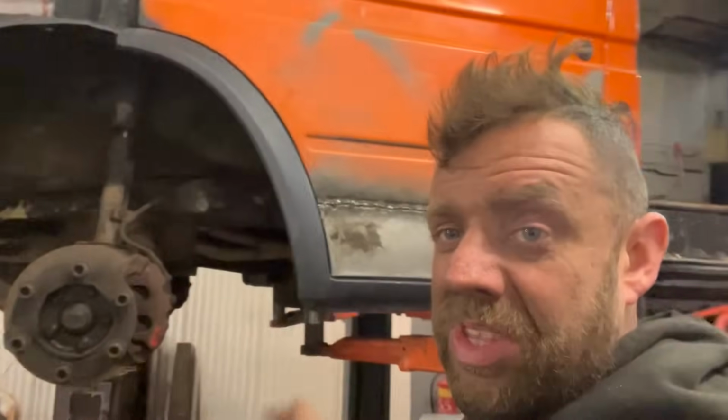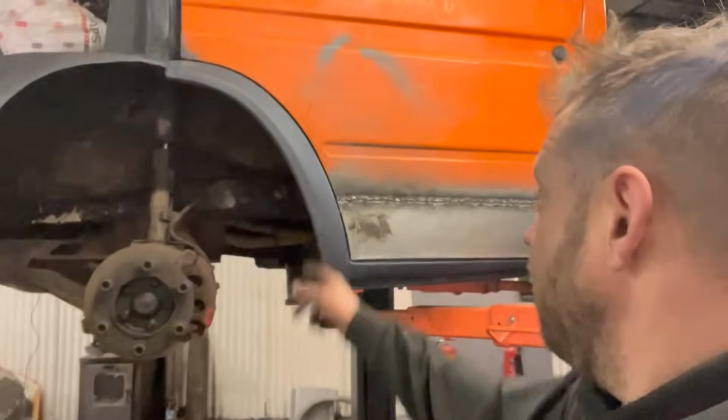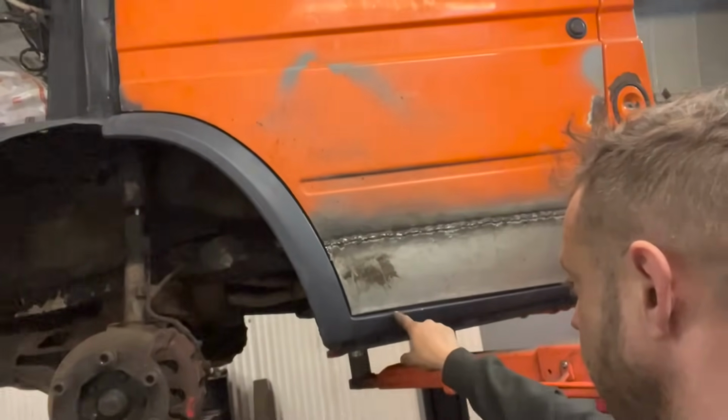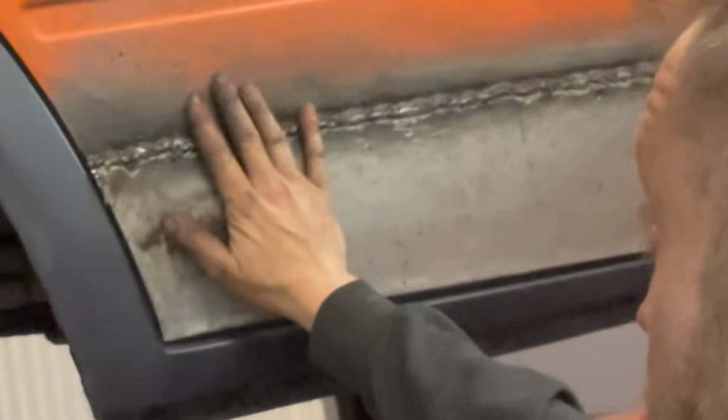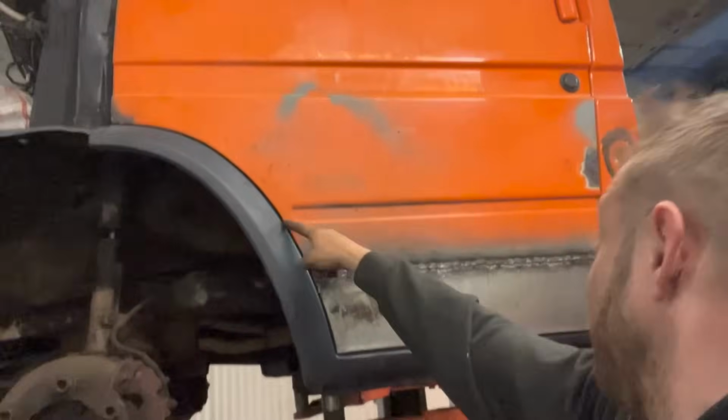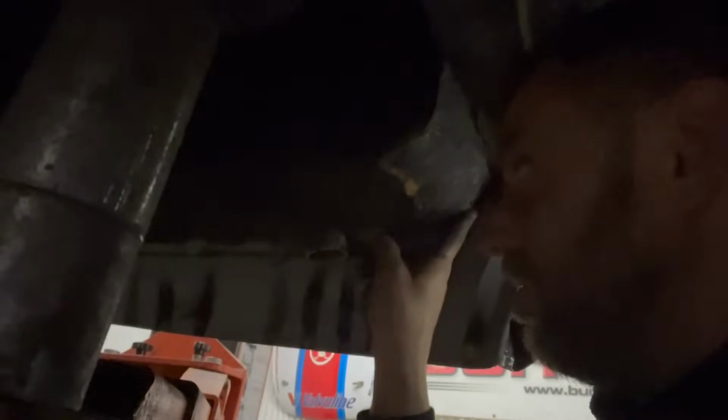But this is all lined up, we're all right. Shuts are all right. Slight bit of filler there just to get that right level, just a couple of mil. Buzz that down, just a bit of filler going on that section there. I didn't want to lap it in here. This is buttoned off, all seams seared up, I don't know if you can see. That is all done. All around here, just got to clean it back, acid etch it, and then we'll run seam sealer through there to join that all up.